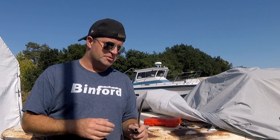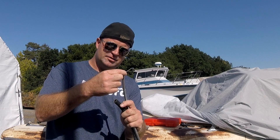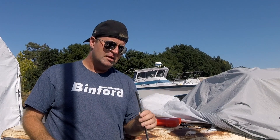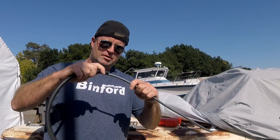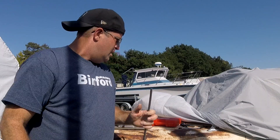What I needed to do is put a little flare on the end of this stainless steel tubing. This is 3/8 stainless steel — it's fuel line for our ectomobile here. What the flare does is when you put a rubber fuel line over it, it allows you to put a hose clamp on, and then it just won't come off because the hose has a little bit of a flare to butt up against. I went ahead and bought the cheap $25 tool.